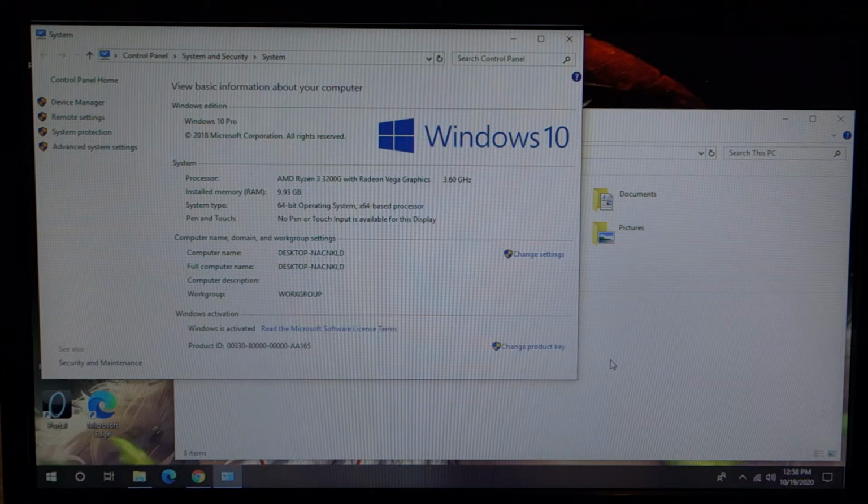Storage, 256 gig SSD, you're looking about 30 bucks. I probably would bump that up to a 500 gig SSD to be able to store some more games on there, and you're looking at under $50, like $47 to $48 for a pretty decent 2.5 inch drive style SATA 3 interface SSD. As far as real world performance, you're not going to notice a huge difference between, say, an NVMe or a 2.5 inch SATA 3 drive for the most part, unless you're doing very specific tasks that will take advantage of that speed. For kids especially, they're not going to notice that.